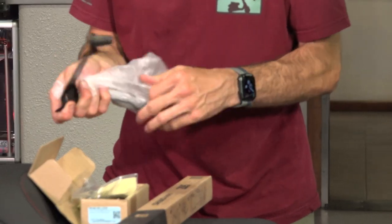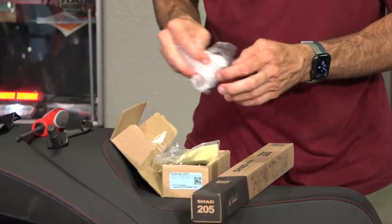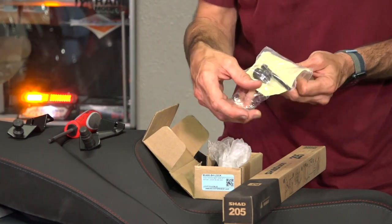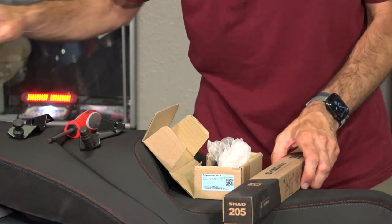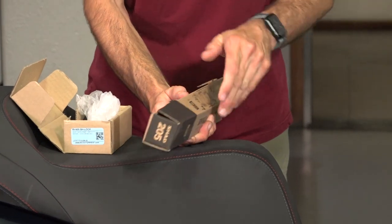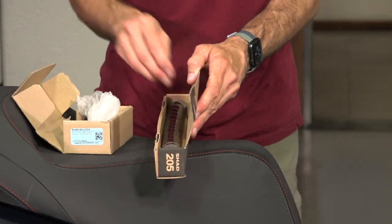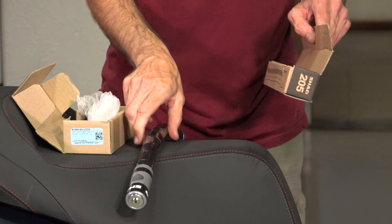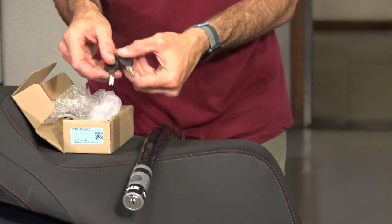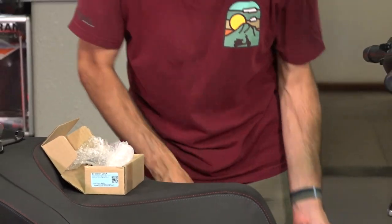So you want to unbox everything — not much to it. The Primavera one comes with a little more hardware, but you essentially have a pair of brackets for the left and the right side. You've got the two brackets and then this piece that replaces the bar end right here — it essentially is the bar end. The next part you have is the actual lock. For the BV and the Liberty, it's a number two size lock — there are different lengths. You can replace that lock itself if needed, in case it's worn out or has issues. It's got nice high security keys.